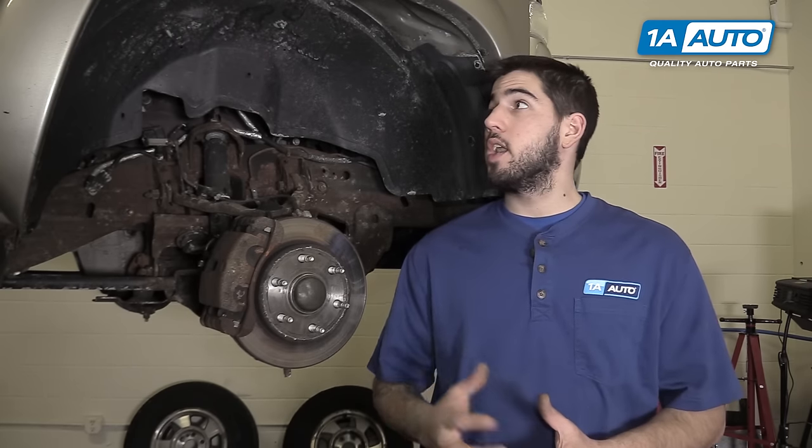We're going to show you how to bleed brakes by yourself using only a bottle and some fuel line to make a self-bleeding tool. Now this video is on this specific vehicle; however, this application can be applied to just about any vehicle. The only thing that's really going to be different is the size and location of your bleeder screws. If you like this video, please click subscribe — we have a ton more information on this and many other vehicles as well as more generic help tips like this.